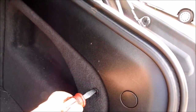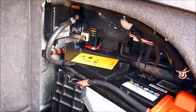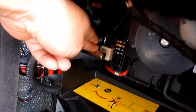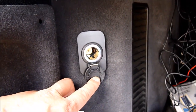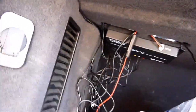The battery is over here. Just a reminder: if you need to jump-start or charge the battery, never use this one here. Never open this. Use the ground for the negative pole here, and for the positive you can go here. This one also has a 12-volt outlet that I use to put my TV tuner whenever I need to.